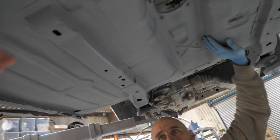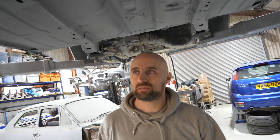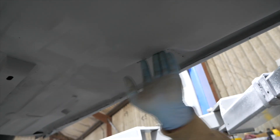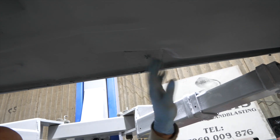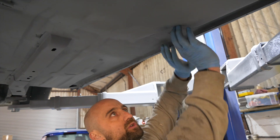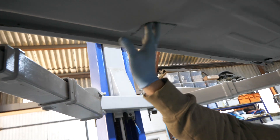So let's start from sort of mid here. What's been done - because what we saw last time was all the welds, sort of welds and cuts and stuff. So here there was a big strip of weld along here, we've dressed them up and tidied them up, flashed them out, and then a bit of primer. Touched up some of the welds we cut through, some of the pinholes, and then a bit of primer. We've repaired - remember it had fallen down and it broke - so beat it back up, got it into shape, same as the other one. The small little plates that were here, we cut off, cut the seat mount nuts off, made a nice three mil plate, a large plate which curls around the edge.